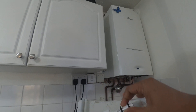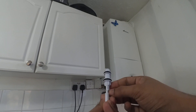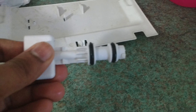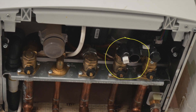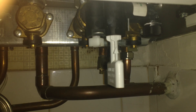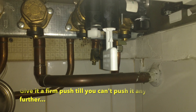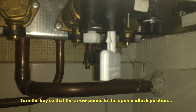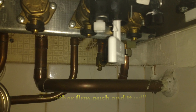As you can see, you will find a filler key inside. If you don't find one, it's probably missing or your boiler needs another method to repressurize. Note the arrow and the two rings. This is the view from the bottom of the boiler — the apparatus in the yellow circle is the filler loop. You'll see an open padlock and a closed padlock on the white knob. Insert the filler key with a gentle push, and once you can't push it further, turn the arrow towards the open padlock, push it again to take it completely in, then turn it back to the closed padlock.